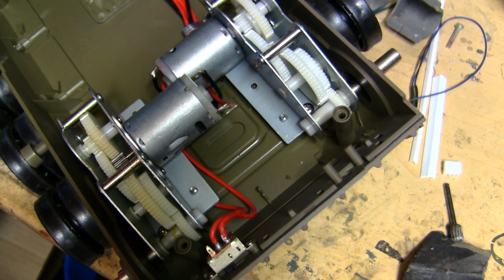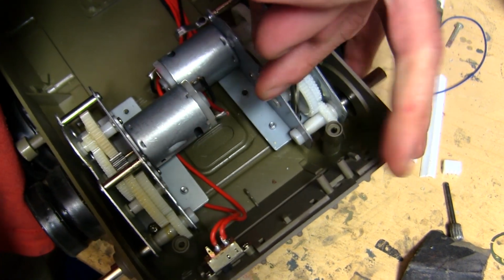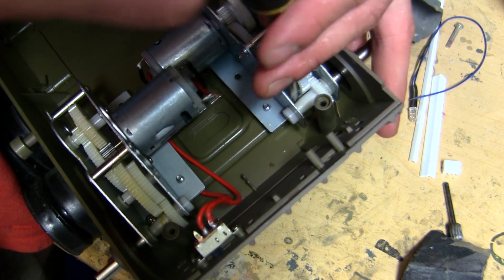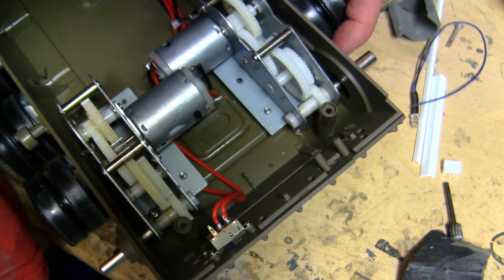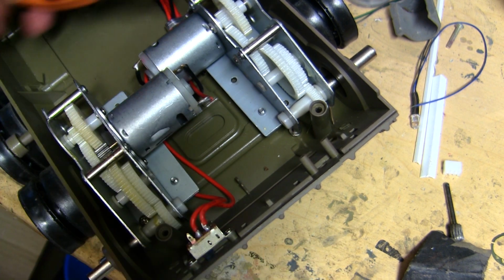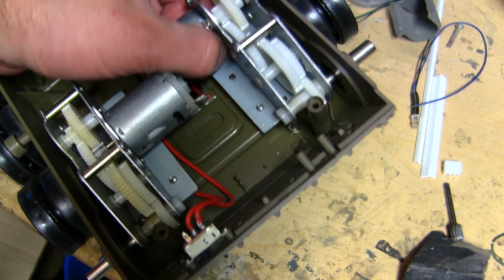Once you are ready to remove the fasteners, just go in here and start unscrewing everything. None of these fasteners are held in place with Loctite or anything like that. It's just torqued into the appropriate locations. It would also help to have a little plier on hand, like this one here, to help grab the fastener when it's been removed, and prevent it from running around loose on the inside, also prevent it from getting lost. The fasteners themselves, again, put in a nice little Ziploc bag where you can easily grab them and keep them on hand.